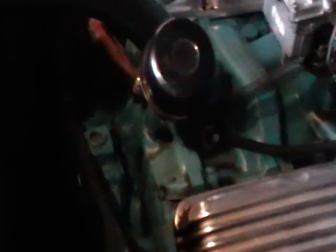We finally got this tank started. The points were off, all the plug wires were in the wrong order on the distributor cap, and the battery was junk. We finally got it to come alive. So now we are going to do the timing.